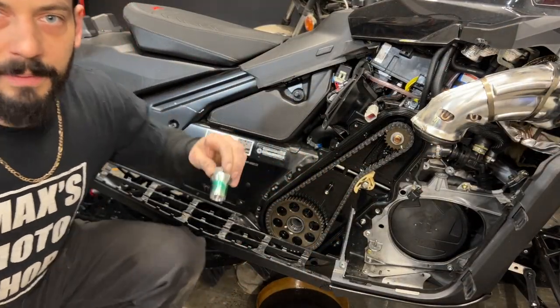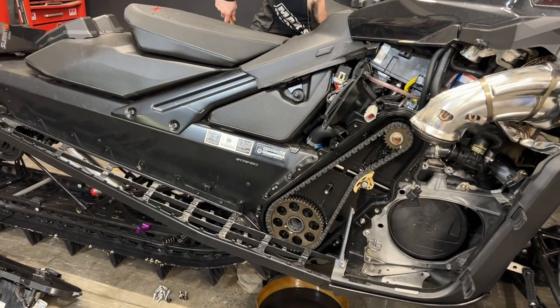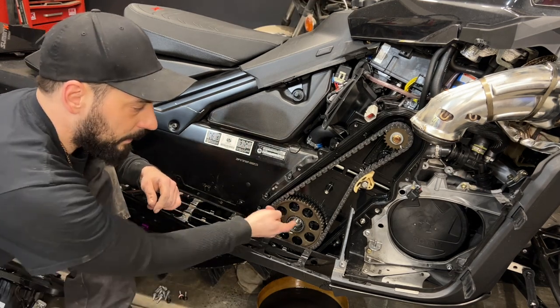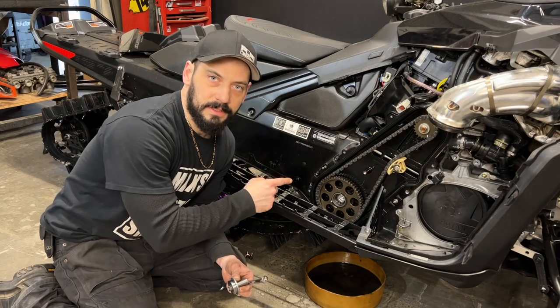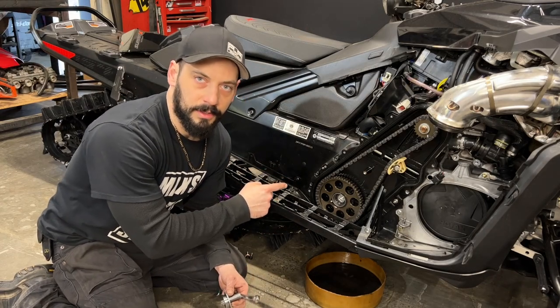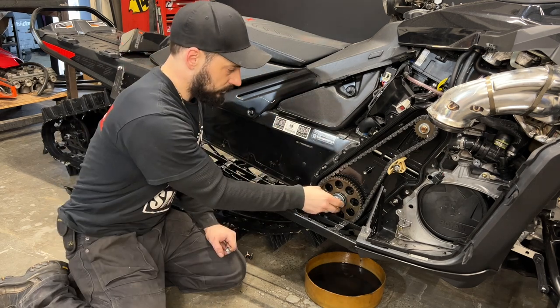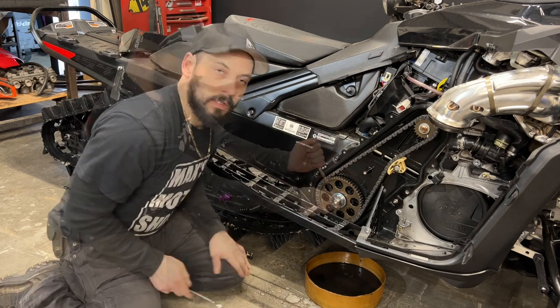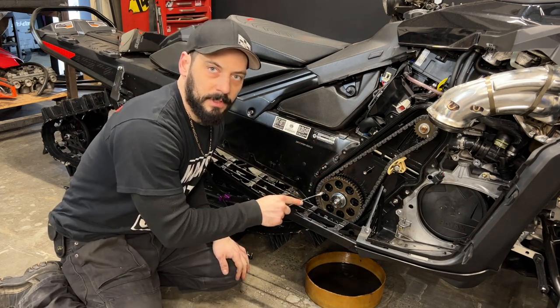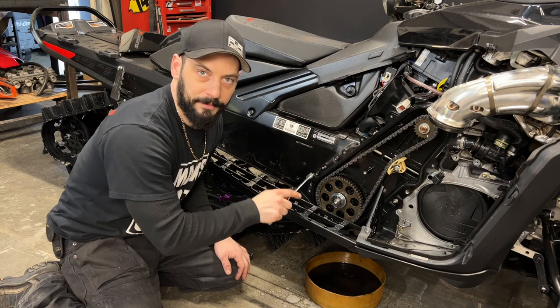Now I'm going to take my insert and push it in from the brake side. It is recommended to use a broom pole. I did have to stick my finger through the hole to line up the insert while pushing from the other side. Once our new retainer is in place and I'm sure there's no sleeve retainer on the threads, I'm going to install the bolt with the washer on it to set it in place — just snug it down. This will help make sure everything's centered and pulled in properly while it sets. Leave it for about an hour and then we'll finish the install.